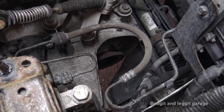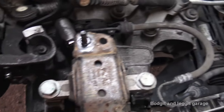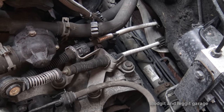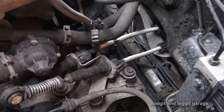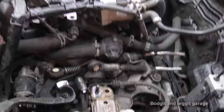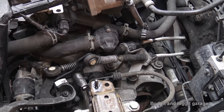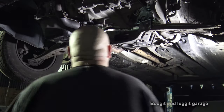I still have to change the oil and put the drive shafts on. As regards the oil, I have to service this so I'll be doing that in another video. The reason we didn't have to take the oil out before taking the gearbox off is the way these cups are designed — you don't have to drain the oil first like you do on most gearboxes. But you still need to change the oil after you've done the clutch. Now we need to work underneath: put the drive shafts on, put the bottom engine mount on, then come to the top and put the battery on.